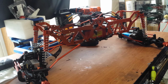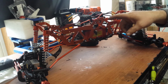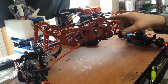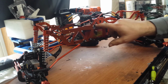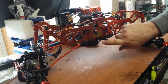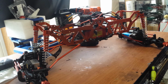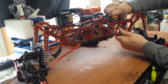All right, so an overview of what's been done so far. I had to purchase two side plates to lengthen the chassis, then decide how to mount and where to position the electronics tray and the battery tray. On this one, after looking at it, I did not drill any holes. It seemed to fit inside this cutout pretty well. There are standoffs behind these 8/32 nuts, and I swapped the battery tray bolts with these stainless 304 bolts because they were longer, and it helped me mount the turnbuckles here. So that was a simple remedy, and it is very sturdy and doesn't go anywhere.